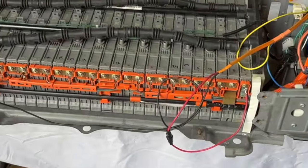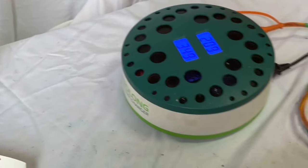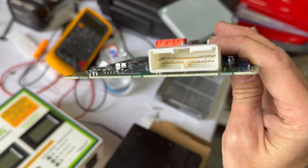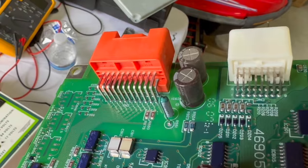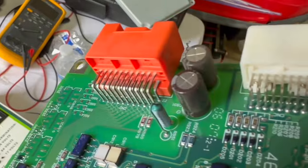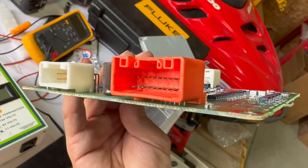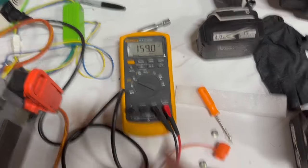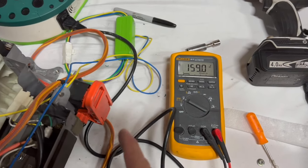We have success! When I tried charging with the battery in the car it went straight to 250V with no amps. Now we're charging at 209V, so we're moving in the right direction. On the ECU corrosion: normally if it were bad it would show on the back side of the board, but it's actually incredibly minimal — just that bottom pin. With the new harness coming, I'll clean those pins and this ECU should be just fine.